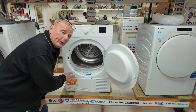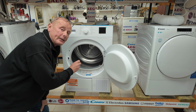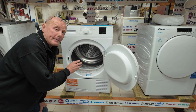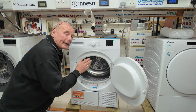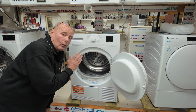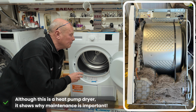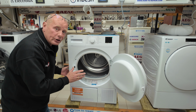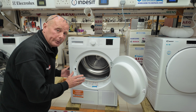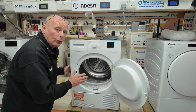One is to pull the cold air, as I said, the other is to circulate the hot air. These fan blades, once a year, need to be maintained. And I would actually take the side panels off the machine and give the machine a good clean once a year internally, depending on how much you use it, of course. 2 years at the most, but really you want to maintain the machine to create the best airflow possible so the machine works efficiently, doesn't overheat and cause problems.